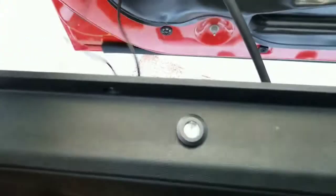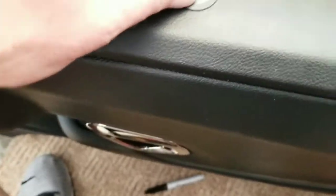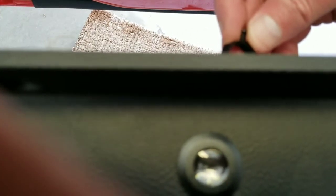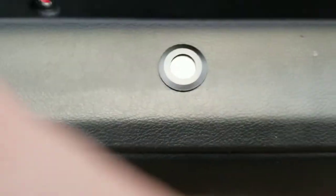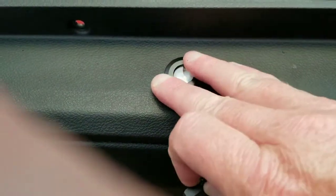That drops down in there, wire goes over there. We'll twist it later and set where we want it. That's nice and flush — sits in there good. Hope for clearance so we don't crash it when we shut the door — it should have clearance. Now we're going to take that set screw piece, come back underneath, run it around the wire, run it up there, tighten it up, then set the set screw and check it before we put it all back together. You may have to pre-adjust it — kind of dummy-set it up on the door and check where it's positioned.